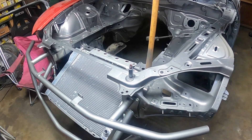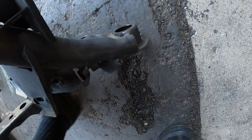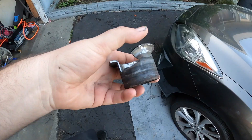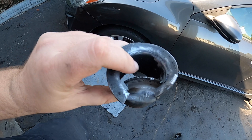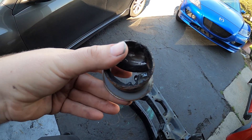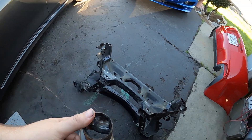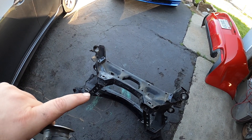The bash bar is done too. So yesterday I spent some time burning out the bushings so we can get to the steel brace on the outside of the bushing that slides into the frame. We cut those out — except on one that was folded in on that side, which was hard to get out. What we did was cut it on the sides and fold that part in so we had something to hit it out with from the other side. These are a pain and I didn't see any tutorial on how to do this, so we just had to figure it out. The other ones are easy — just a simple punch out.